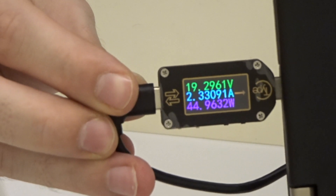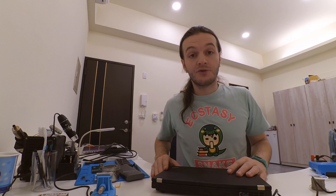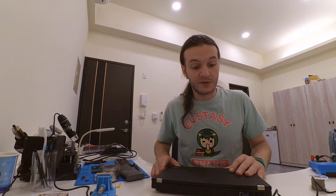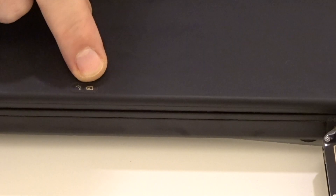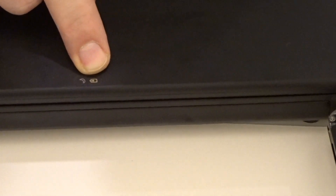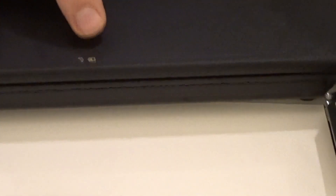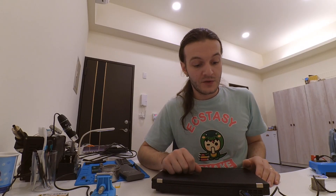Normally this laptop uses a 65W charger, and our charger is capable of 65W, but it is only pulling 45W at the moment. The battery is quite low, so that could be the reason. As you can see, we have an amber LED flashing — the battery was indeed very low before I started this procedure.